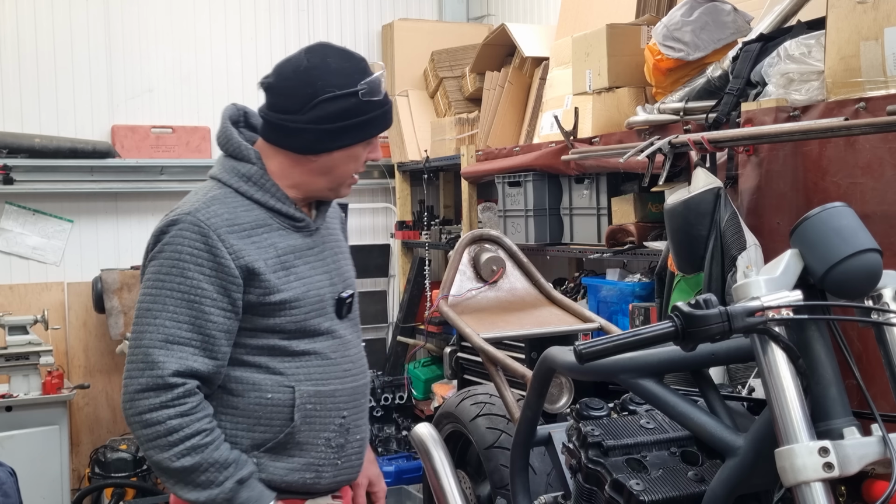I've also got a fuel filter for the van. It's never had one. I can't see anything that says when it has ever had one. But it did that thing again where it cut out, and it was, again, a fuel pressure thing. So I figured, well, it could be just as simple as the fuel filter that's blocked. So exactly the same code, and I've changed that sensor, so we're going for that next. But that's going to have to wait, because it's still tipping it down with rain.